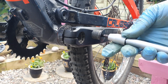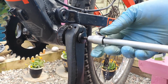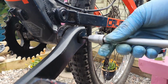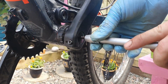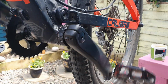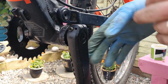Okay, so last job is we need to torque on and take out all the play for the cranks. So we've got this top cap or end cap piece, and the idea is I'm not tightening it all the way in, and you can see how free it should be. So if I over tighten it too much and it starts to bind up, I know I've got it wrong. However, everything's been greased shaft wise, as well as the nuts and bolts in between, so this should pull in nicely as it is, and about there. And I'm just going to take a hold of the ends just to make sure it's still nice and free. But if I grab the crank arm and pull back and forward, there's no play. I can't feel any play between them.